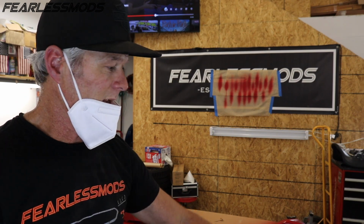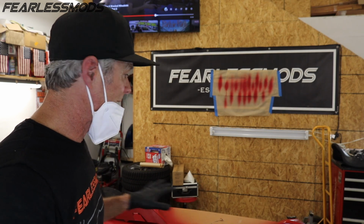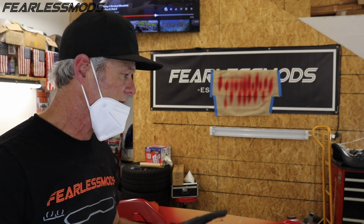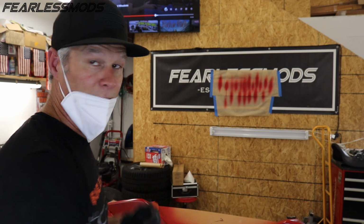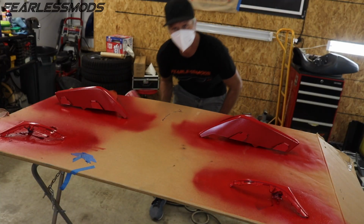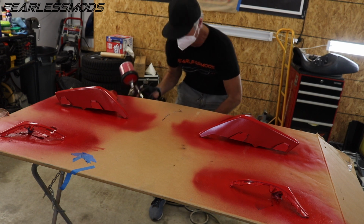We've got two coats of base coat down on these parts. The mirror pieces that were chrome underneath, they look fantastic. They're ready for clear coat with two base coats. The black pieces of plastic still need another coat. I think one more base coat is going to get us the rest of the coverage, and then we'll be ready to pull the tape back and wax and grease remove, make sure our new tape lines are still good to go, and then clear coat all of these parts. I think we're base coat complete. We'll let these babies set a minute while I mix up clear.